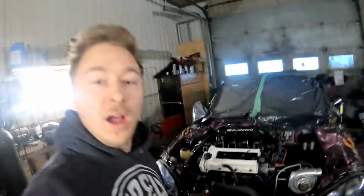All right, I've got two things to do before I start it. These are the last two things. I need to put my fuel pump back on. I need to get that working, get power to it, easy peasy, just plug it in. Second, I've always had E85 in this car. I put 87 in, and E85 requires more fuel compared to 87. So if I started it up, it'll smoke really bad because it's gonna be getting way too much fuel.